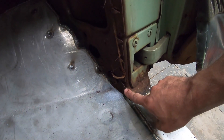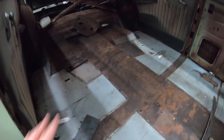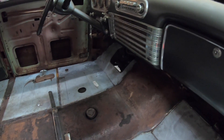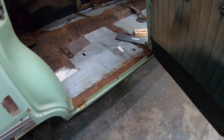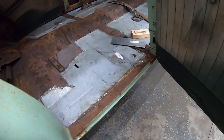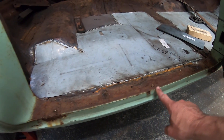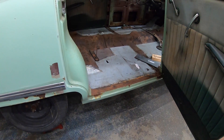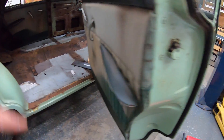Something else you'll notice is the floor doesn't come all the way to the A-pillar here, so I'm going to make a little fill panel to go here. The floor is nice and solid - all the floor pans are in. For those of you who haven't seen the last couple of videos, all the floor pans are in. I'm actually ready to put the pedal assembly and stuff back in on that side, so I have brakes and a gas pedal. The plan for this weekend is, you can see I've already welded the floorboard to this part of the rocker, so I'm going to split the rocker here instead of replacing this part because it's still solid. I don't want to replace more metal than I have to - I just want to replace what I need to replace and leave the rest alone.